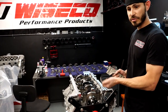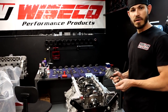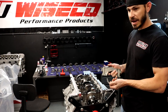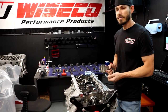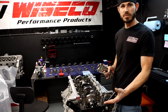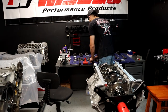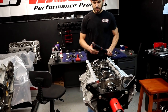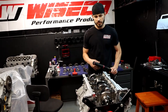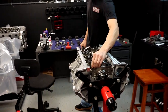That will give you proper thrust clearance. We're looking for somewhere between seven and twelve thousandths, and that will also ensure that you're not going to have any premature bearing wear from positive pressure coming from the transmission, whether it be a clutch assembly or torque converter. I've already torqued number one through number four all the way. I don't have the side bolts in yet, but number five is nice and loose still.